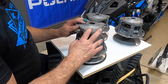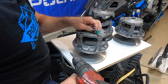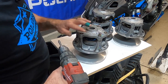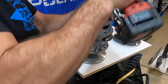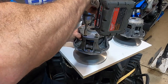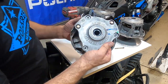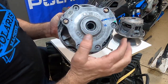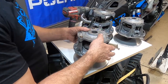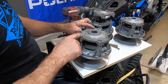I'm just going to show you how I do it. Pulling the clutch cover off one of these other ones. Now, an interesting thing about these bolts — a lot of the bolts on your machine are metric, but this is actually a standard bolt, it's a three-eighths. I've loosened all of these a little bit. I took out four bolts and left two that are pretty much straight across from each other. The best thing to do if you don't have a spring compressor is have someone hold this so the spring doesn't pop it apart when you take the last two bolts out.